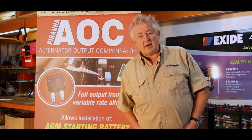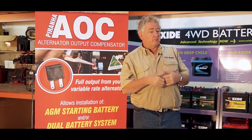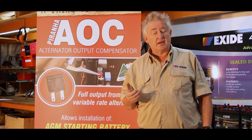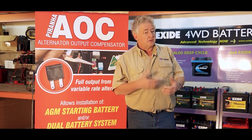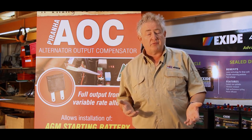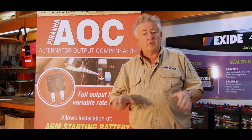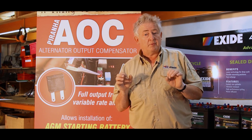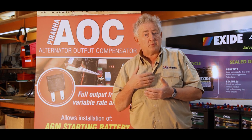In conclusion, we've seen the potential risk of using the internet-based substitute product, which is actually completely wrongly mislabeled as a fuse at one and a half amps. Cars that have smart alternators typically need to get the voltage up so you can charge batteries correctly. If you're running batteries with different chemistries like AGM batteries, you need a higher voltage. People often ask why the car has a smart alternator in the first place — the answer is simple: it's to do with emissions and fuel economy. By turning the load of the alternator down to a lower level, we improve fuel economy and lower emissions. The first of these smart alternators was simply temperature compensated — when the catalytic converter wasn't up to temperature, the alternator didn't charge. They've now got smarter and smarter, and that's where our problems come from.